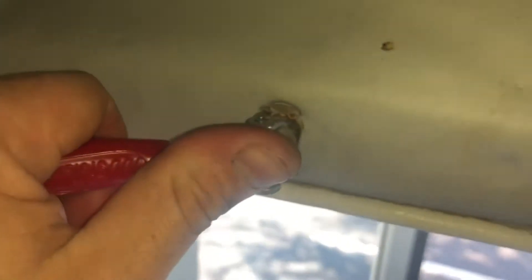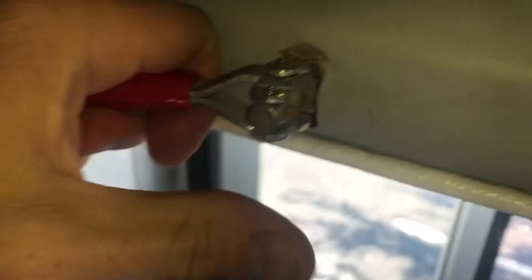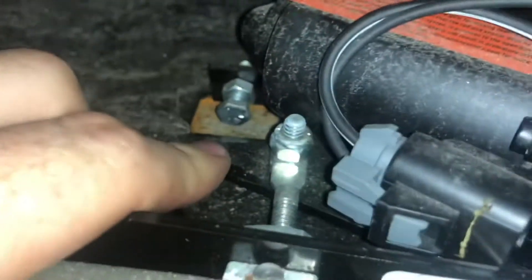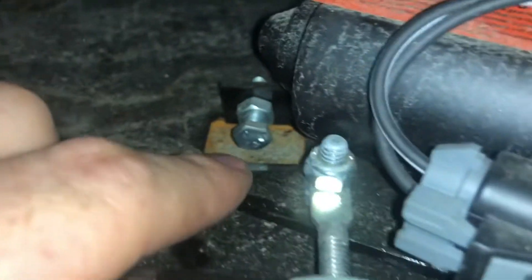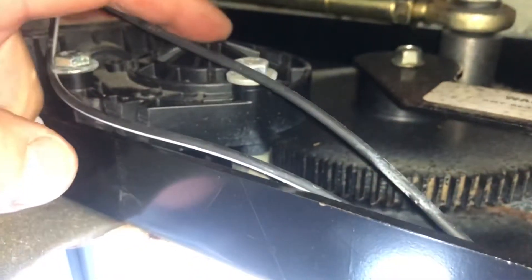This actual mechanical arm right here — you can see that — this is what moves. That's where you've got your handle, the in and the out, the ying and the yang. For some reason that is jamming up right here. Here's our mechanical stop, here's your lever that's pushing that in and out. What we're going to do is get a lever on this, see if we can assist that forward, and that'll bring the teeth of the sprocket underneath this motor into contact.